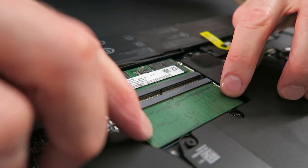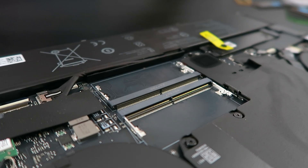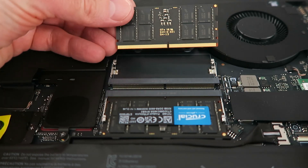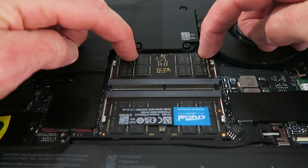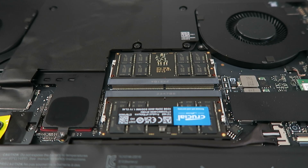Replacing the RAM in your laptop is generally really easy. All you need to do is gently push apart the spring clips on the side of the RAM and the RAM module should pop up, so you can just pull it right out. Then take your new RAM modules and slot them into the socket, making sure that the orientation on the RAM stick itself matches the orientation of the socket. Push it in, push it down very gently, and you should hear a soft click as everything snaps into place.